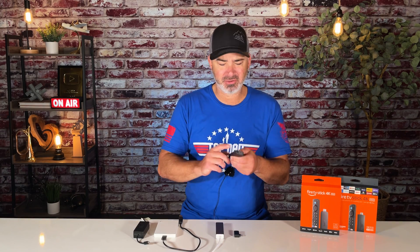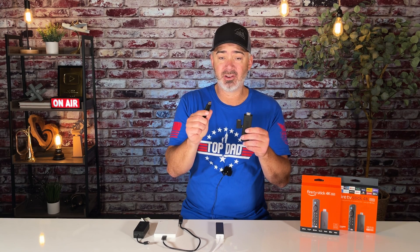First of all, you need the Fire Stick, but you don't need the cords — get rid of those. You need an OTG adapter. It's important that you get the right one; I'll put links in the description section. You plug that into the one port on the Fire Stick. Now you have a USB port and a pass-through power cord. What some people do is just get a little thumb drive and plug that in. You could do that, but the thumb drive needs to be really small — I'd say under 64 gigs.